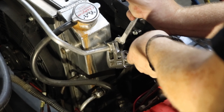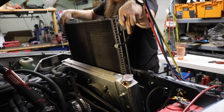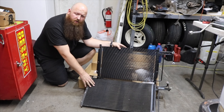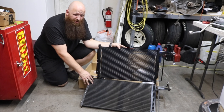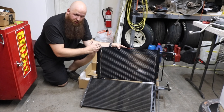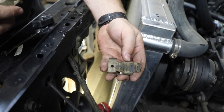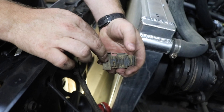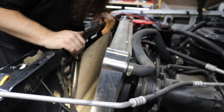You should always back up your AC lines because you'll destroy your hard line if you don't. It should just pull right out of there — it's about two inches shorter. This is what's called a parallel flow and this one's called a tube and fin style. These are better for R12 and these are better for R134A. The aftermarket quietly swapped over to parallel flow and you can't even really find the tube and fin anymore — and when you do it's like $250. It's easy enough just to remount the mount bushings over a little bit to make it fit.